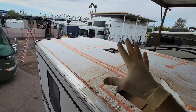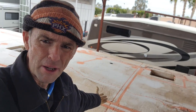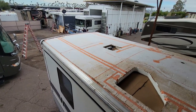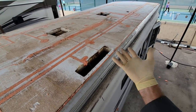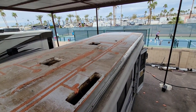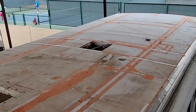This will make the roof a little bit stronger when we laminate the foam to the Luan. If you were to total up all the square footage of this orange channel it probably would equal about four by eight, or 32 square feet — so it's a lot more gluing surface that we have now too. Now it's just going to be time to laminate just like a normal Winnebago roof. This foam step is not a common step to have to do, but because the roof was compromised so badly — especially with that ceiling panel on the inside — I'm trying to do as much as I can to make sure it's going down the road safely, along with the aluminum tubing that I put in.